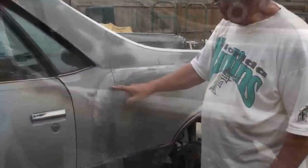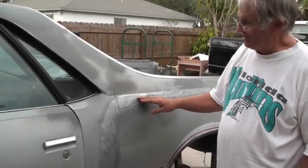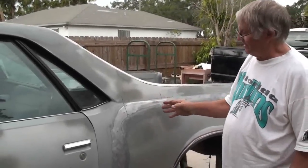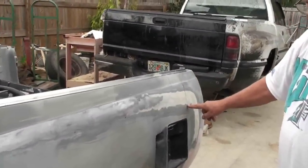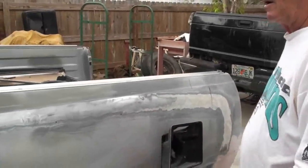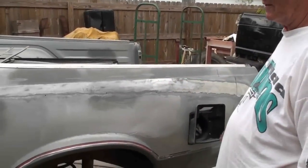All the holes have been pre-drilled in the body using the bonding strip as the template. So when we get ready to glue this on, we don't have to stop and figure out where the holes should be. They're already here. We've put an index mark on this front hole and one on this back hole. We'll use pilot screws to set the thing on there, so as you're trying to put it on, you're not trying to figure out where it goes. It'll just go there. Two pilot screws, one here, one there. Then we put all the rest of the screws in.